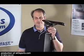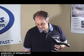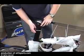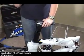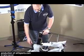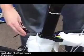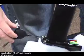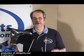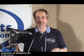All right, seat post and seat goes into frame set. Now this is a P3 carbon, so there's a couple steps we want to be careful with when inserting the seat post and torquing down on these things. So number one, just insert the seat post to a reasonable depth. And then we want to take our 4mm Allen wrench on these nuts, and we just want to tighten them to be snug. Don't be cranking these things down. We're going to be using a torque wrench in a second, but I want enough to where it's going to hold this seat in place so I can get up on the work stand. Okay, here we go. Now just go crazy and take all that stuff off.